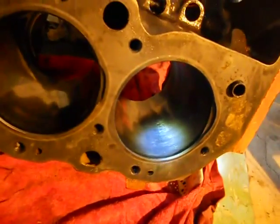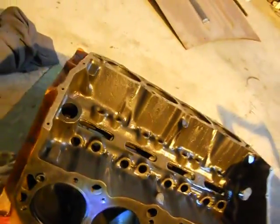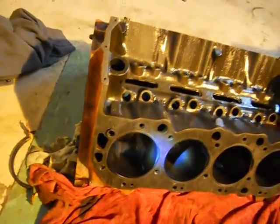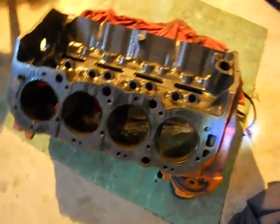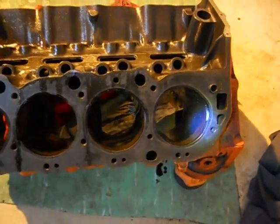And they didn't get a lot of the scratches out neither. But that's what it was. It was a loose piston problem, piston knock. Basically, they honed it with their hone about 7 thousandths. Standard bore is supposed to be 4 inches, 93 thousandths. I come up with 4 inches, 100 thousandths, plus a hair more.